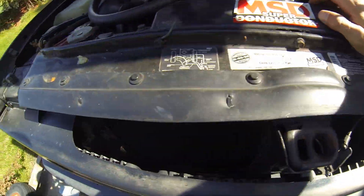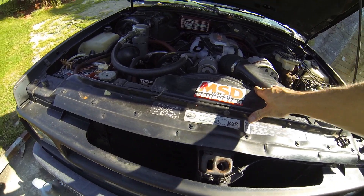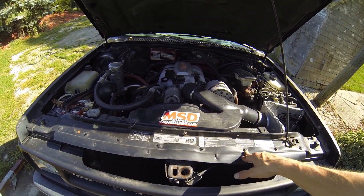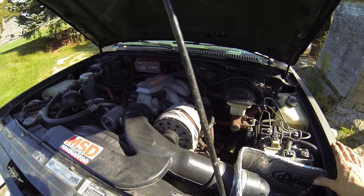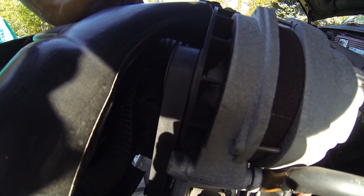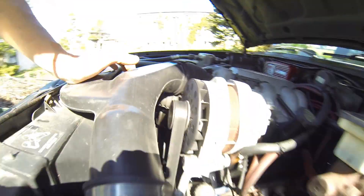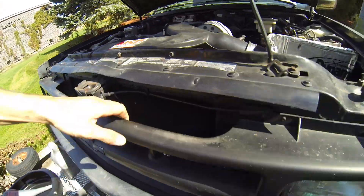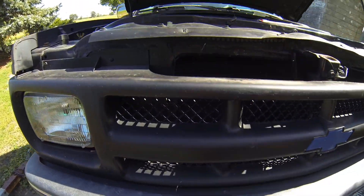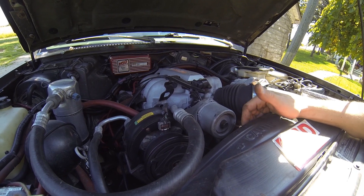Looking at the big space I have in the front of the radiator, I'm thinking I'll try something - the Cadillac DeVille parked in the barn has cooling fans that would totally fit behind this grill. I've got one in here right now that came off my Grand Am and it just barely clears. I had to remount the fan with a spacer to push it closer to the rad, but everything works. I'm thinking of adding an extra cooling fan mostly for the air conditioner, because the A/C doesn't seem to kick out much cold air - probably because the fan isn't moving as much CFM as the original mechanical fan would have.